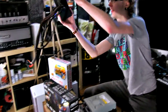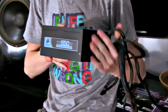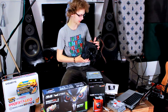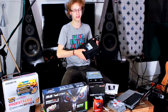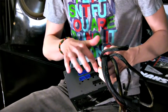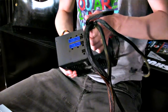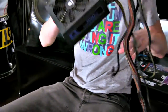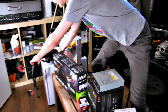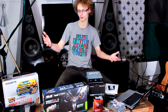For the power supply, I also pulled this from my old PC. This is a Corsair HX850 — an 850-watt power supply that is 80 Plus Silver rated, so it's a very high quality power supply, and it's also semi-modular. So you can plug in just the cables that you need, which is excellent. This power supply is a little overpowered for this particular build, but that just means it's going to run quieter, which is of course one of the main purposes of the PC.